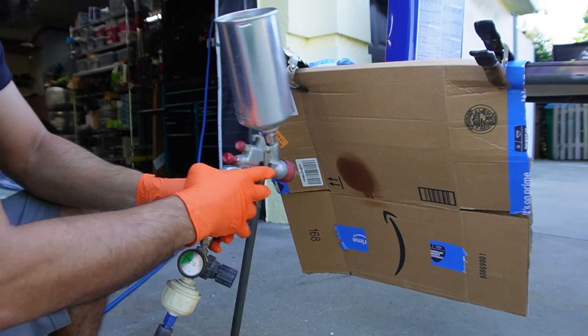I applied the filler, repaired whatever little spots it had, sanded it down, eliminated the high spots and low spots, and now the primer is going to fill all the scratch marks and make a new foundation. Then I can block sand everything and make it nice and smooth for the paint. Right now I'm creating an easier way to pour this primer out - it will be filled to the top.